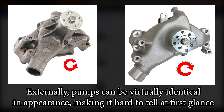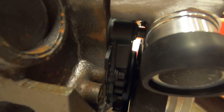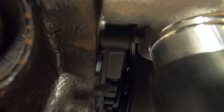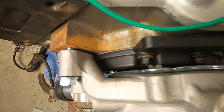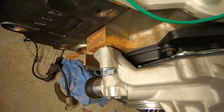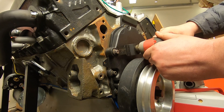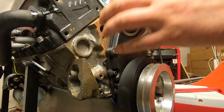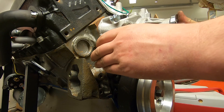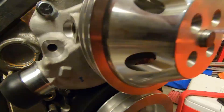For this reason I had to purchase a clockwise rotating water pump, since both the crankshaft turning clockwise and the water pump are both coming into contact with the underside of the V-belt. On a factory 1999 Suburban the outer side of the serpentine belt would end up rotating the pump counterclockwise. Ordering the wrong water pump is a common mistake — people end up overheating their engine and can't figure out why, so it's definitely important to factor in your belt configuration when selecting a water pump. The main clearance issue with installing this short water pump is one of the timing cover bolts, so we'll cut it down to get it out of the way, and from the looks of it everything clears any moving parts.